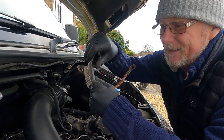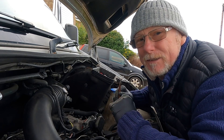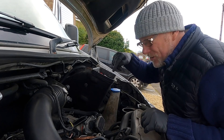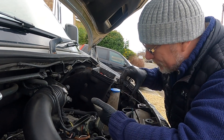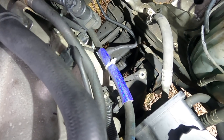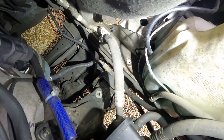I've been cleaning the ends of this cable. This side you can see is very, very corroded and very dirty, and on the chassis itself it's unbelievably rusty. I'm hoping this will cure all my fault codes that keep coming up due to under-voltage. Let me get a torch and show you where this cable goes, just in case anyone else out there is having similar problems. You can clearly see the corrosion around the chassis bolt — one end goes there, the other end goes to the top of the engine mount, and again you can see all that corrosion. I'm going to clean both ends with a wire brush and put it all back together.